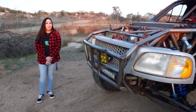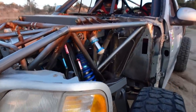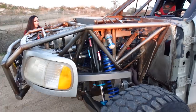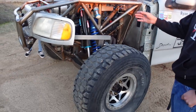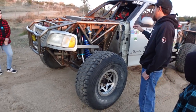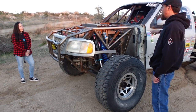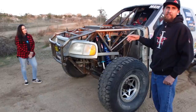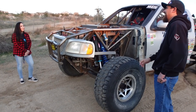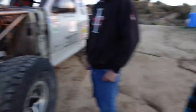A lot of them have grown up and gone a little soft — not as mean anymore. So we decided to set the motor back to get the right shock geometry, angles, and motion ratio. We ended up setting the motor back almost 14 inches into the cab — we cut the firewall out. The truck was already caged at the time. We cut the front end off, and about two days later we found out we were pregnant with my son, so there was no turning back.